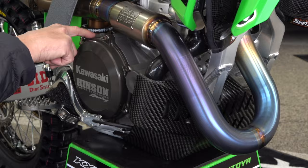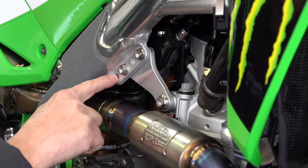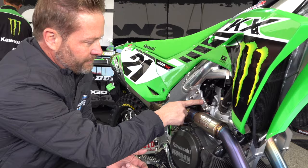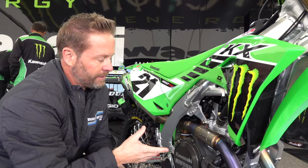All the coatings here on the side are really cool. They run Hinson Clutch, full titanium kit, obviously looks great. And then the motor mounts — they've got holes here for a different mount, which will change the character. When you change the mounting point, it'll be a little softer or stiffer depending on the material. Even changing the bolts you use here — if you go from titanium to steel, it'll change the character. I know it's crazy, but it actually is true — I felt it myself.